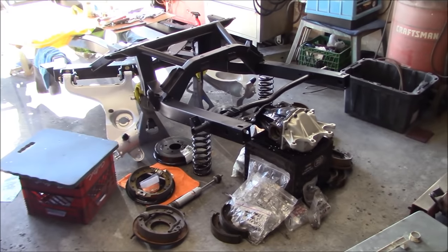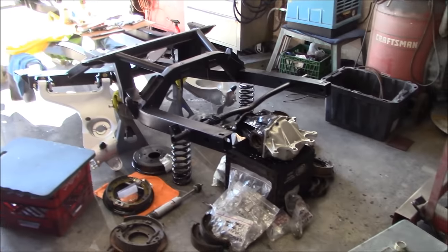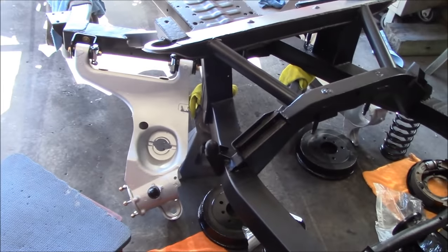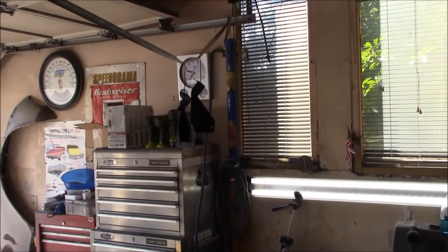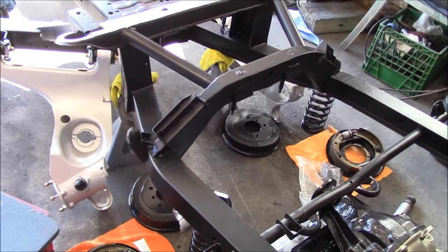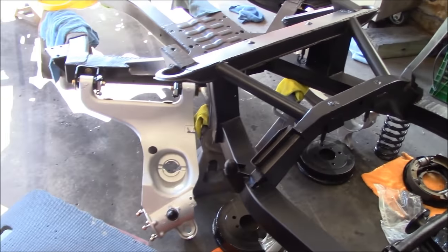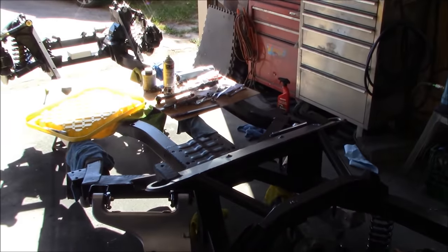Good morning. Welcome back to the Tash Mahal. It's 9:30 on August the 1st, 2020. We're going to pick up where we left off yesterday. We just finished the brake back plates last night and this morning we're going to continue on trying to get the rear suspension put back together. The tube shock conversion brackets are over there hanging — they dried up nicely overnight. So the first thing I need to do is tap those holes out for the mounting locations and find some hardware, then get the trailing arm suspended and the coil spring in.